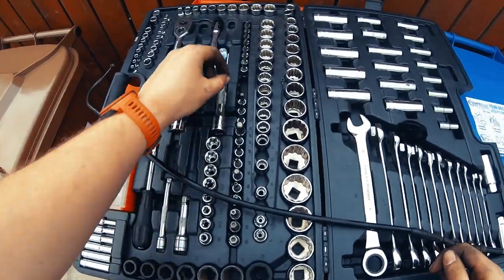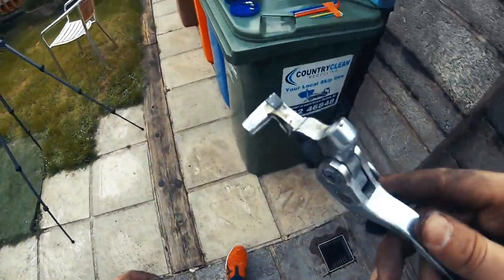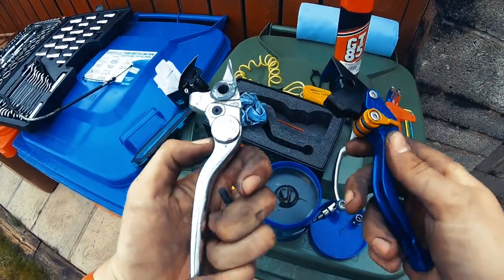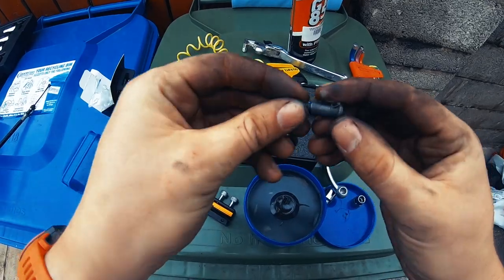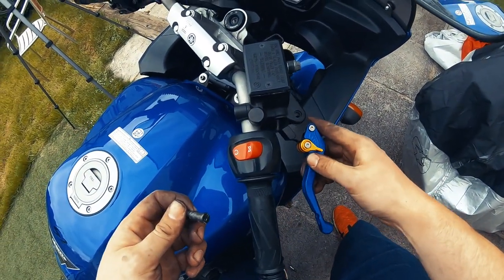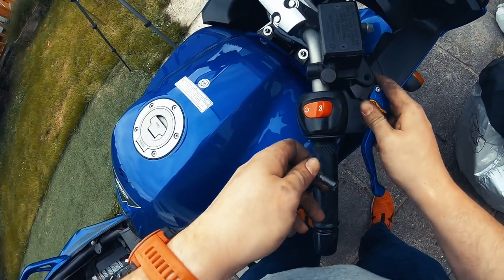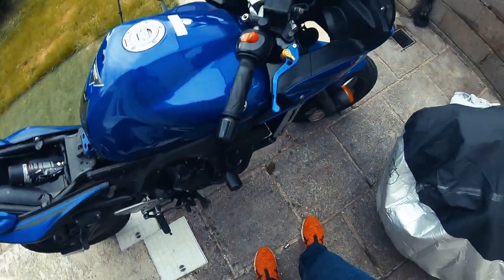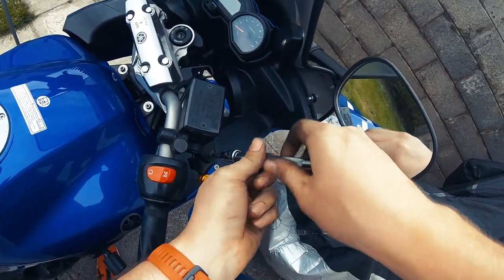The tank is back on. Now we're going to change out this brake lever — it needs a 10mm and a flat head. This one is slightly different to the other side because it's a lot easier: there's no cable to connect and there's also no bearing. Apply a little bit of grease. The important thing when putting this back in: make sure that little cup catches the push rod, because that is part of your master cylinder. If that's not seated, your brakes aren't working no matter how hard you pull. So do make sure it's sat back in there, otherwise you just have no brakes.